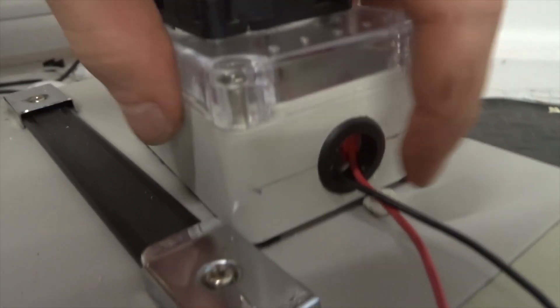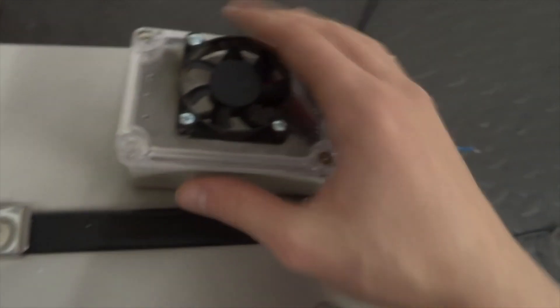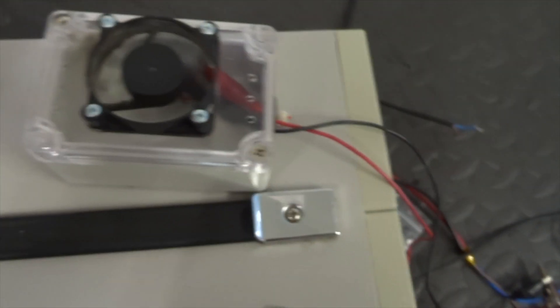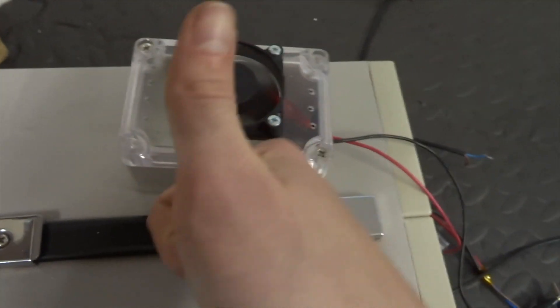This is the one for the boost converter - I've got a 22mm hole with a 20mm grommet, that's a nice fit. There's a fan on the top with a laser-cut hole, and some small holes drilled on the side so that when I turn it on the air comes in at the top and can escape out of the side holes.